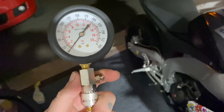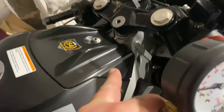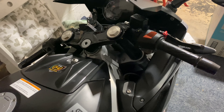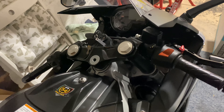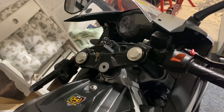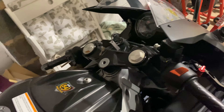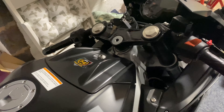I'm not going to show you how to take the tank off, but you want to do this bolt here, this bolt there, the one on the other side — lift it up, take the seat off. What you want to do is get the bike up to temperature before you do the test. If you're not going to get your bike up to temp, or if you've got a non-runner, expect to get about 10 to 15 PSI less on a cold engine than on a warm engine.